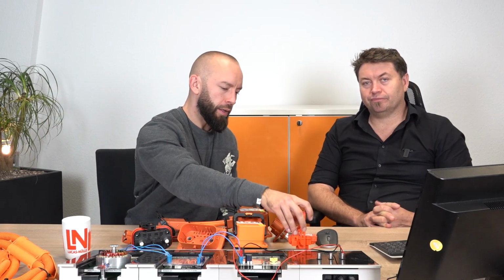The question is, what happens if those contacts get welded shut? That's a good question. But the technology has changed a lot now, and manufacturers are obviously confident enough that it won't happen. And you have to say, of course, in that case it happens exactly what we said at the beginning, what we definitely want to avoid, that we disconnect a high voltage connection. But on the other hand, when you disconnect that, you don't have a peak current on the system. It's not like we have 500 amperes, for example, running through it, as when you do acceleration or recuperation. So it's not like you disconnect a current of 500 amperes or more.